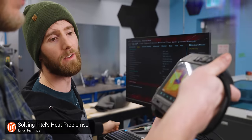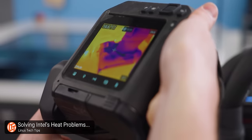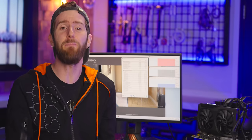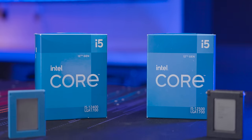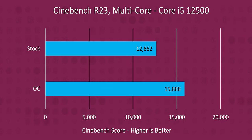On both sides, realistically, we have had a similar issue where most of their products are running so close to the red line out of the box that even if you can keep them cool, there just isn't a ton of headroom. And it's these budget chips where you really feel like you're getting a lot more bang for your buck. Off-camera, we pushed it even further to a stable overclock of 5.25 gigahertz on all cores with 1.2 volts of juice, and we saw our performance improve by leaps and bounds. Cinebench is up 25% compared to stock speed and still under 85 degrees.